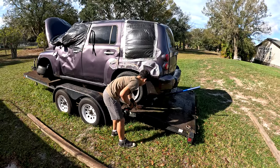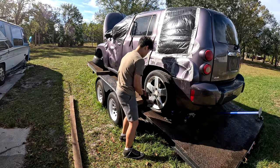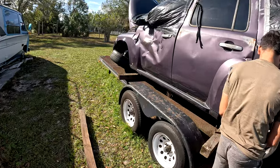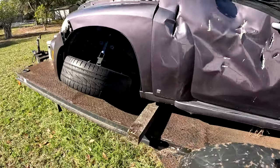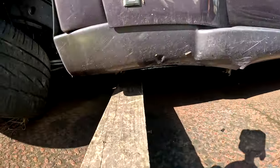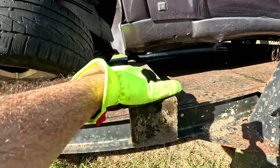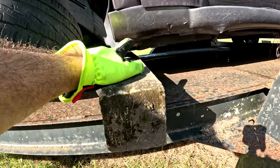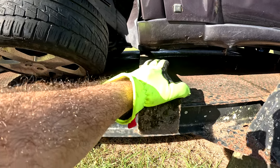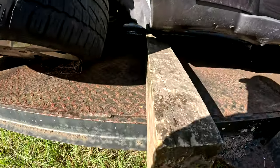90% already on the battery. We're using the new GoPro 12 Black. So now I have 4x4s right here. This will hit the frame — it'll hit the exhaust first, then hit the frame. But we should be able to set this down on here. As long as we can get the jack out, that's all I care about. If I need to, I'll double stack it. I really don't want to, but I'm afraid it'll fall over.